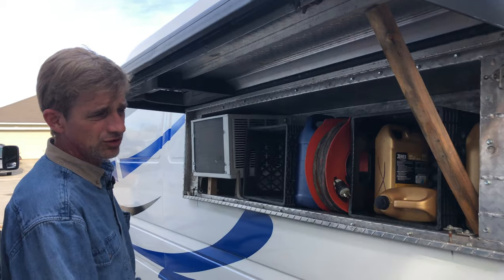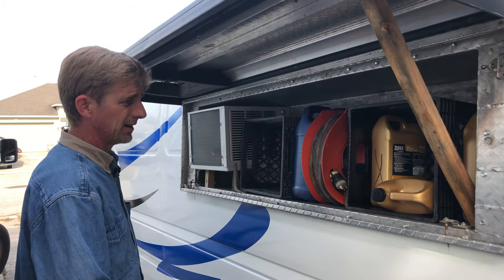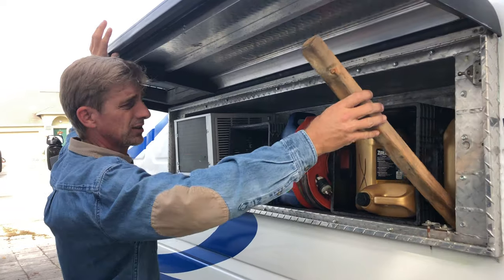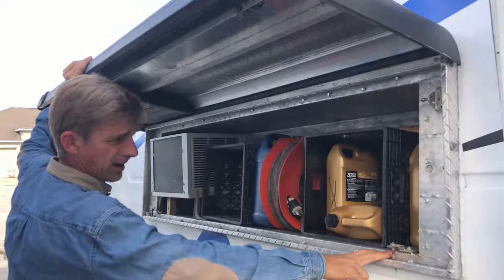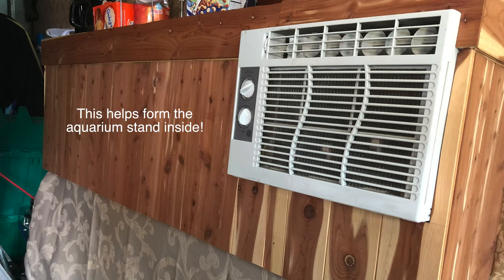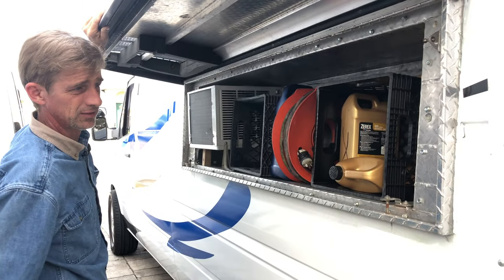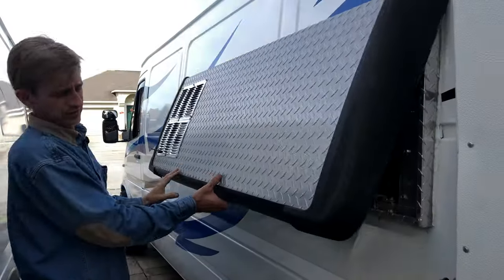Since I don't use the generator very often — I've got a 200-amp alternator and a 400-amp-hour battery pack — I can run that air conditioner any time I want, up to about six hours depending on how hard it's working and how often it's cycling. Picking this toolbox was important: it has a flange around it all the way, which gave me a surface to bolt to the van and restructure where the damage was done without causing any weak spots. It might not be DOT approved, but I think it's better than new, as the old Midas commercials used to say.